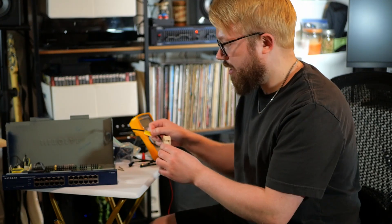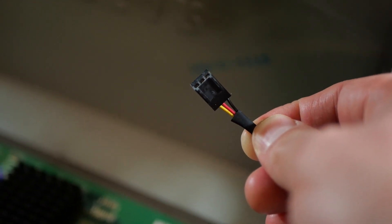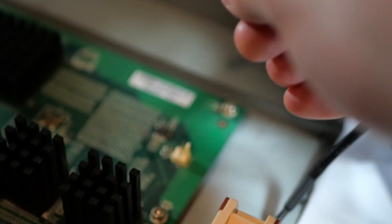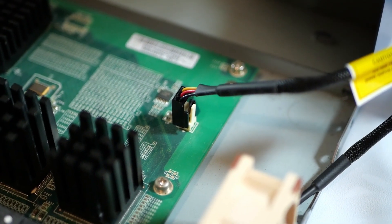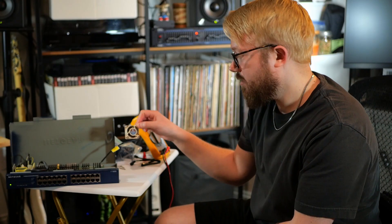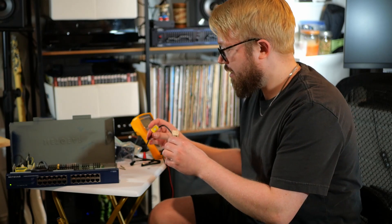To show that, I'm going to plug it in and power it on. Here we have the fan header from the Noctua fan — you can see the yellow and red wires — and we're going to connect those up to the two pin fan header. We've just turned this on and you can see it's running. But you can't really hear that it's running. Now that we know that it's working, let's mount this up with the hardware, plug it in, and we'll close it up.